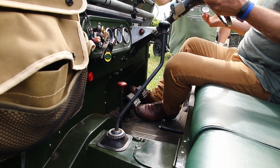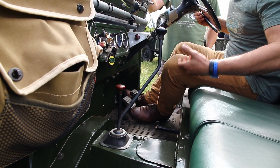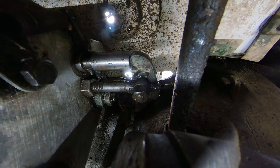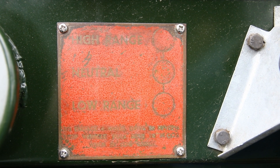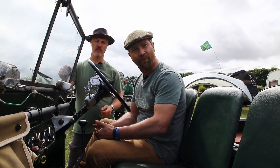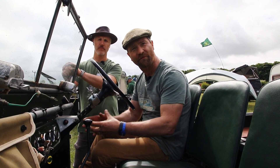When we get to off-road situations where we need to control the vehicle slower and use the torque of the engine more efficiently, we pull the lever back which gives us our low range gearing. We've got a plaque on the bulkhead as the original manufacturer gave you a guide of high, low range and neutral. It's a very simple four-wheel drive system that we don't need to think too much about — there's not a lot of forward planning required because we're always in four-wheel drive.